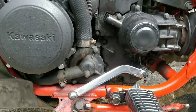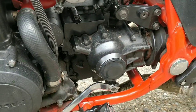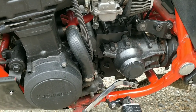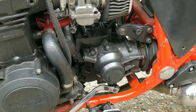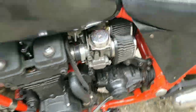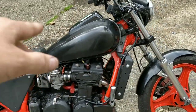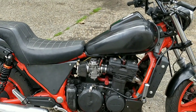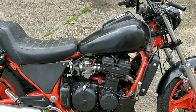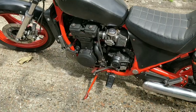It's weird — I see these kind of upgrades and I just don't always trust them. So if your Kawasaki is leaking from the bevel at the back, that's what you need to do — you need to take out the old seal if you have an old style seal, and then you put in this new upgraded part, and that stops the leak. This is going to be a short clip for people who are having the same issues, cause that was a great fix. I'm just waiting for everything to settle so I can look at the oil level. You gotta let a bike sit for a few minutes. I'm going to top up the oil level cause it lost a little bit, and fire this thing up, make sure it's not leaking anymore from the side. It's not at the moment, so that's a good start. That's in so tight guys, there's no way in hell oil's leaking past that.